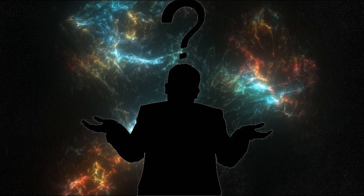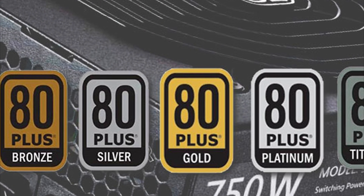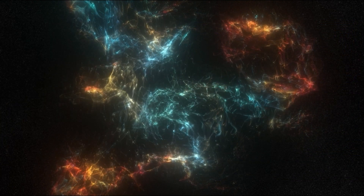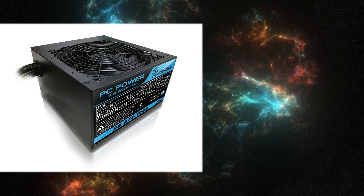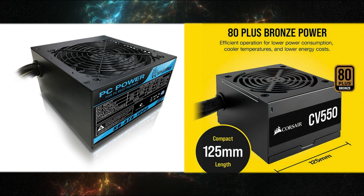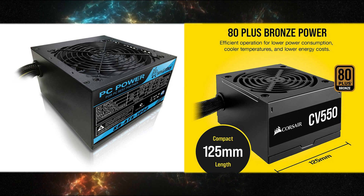What's a good and a bad power supply? A lot of this is made easy for us by the 80 Plus power rating — it's pretty easy to understand and there's a nice chart to follow. It means that at a given percentage of load, a power supply will run efficiently at the watts it's certified at, at 80% or better. As you go further down the rating, that efficiency increases. If you have a power supply with no rating — like a 1000-watt power supply, for example — it may only actually be pushing 400 watts to your system despite claiming to be 1000 watts. Whereas a 550-watt 80 Plus power supply guarantees at least 80% efficiency and will likely outperform that unrated 1000-watt unit.